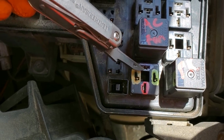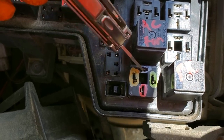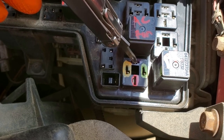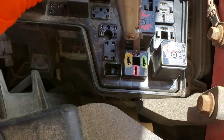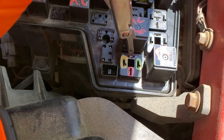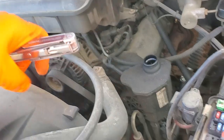You yourself can take battery power and put it into this pin, and that should result in the engine turning over — assuming the starter is good, the battery is good, and the engine is not locked up. Be careful doing that: make sure the truck is in park and that nobody's hands are anywhere near the engine.